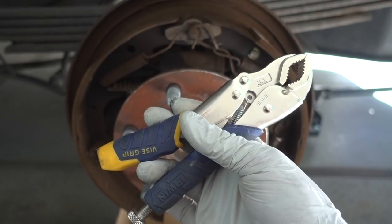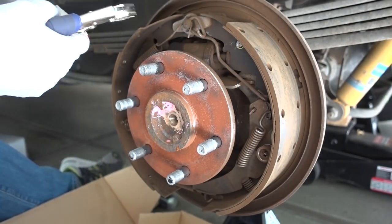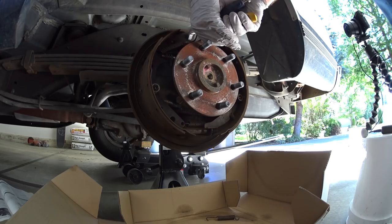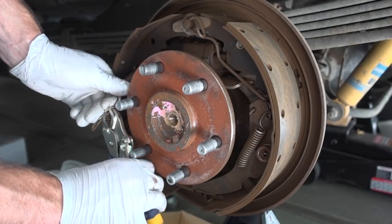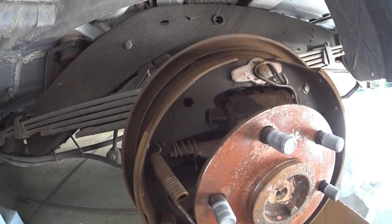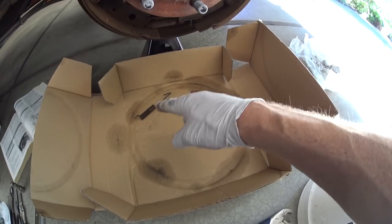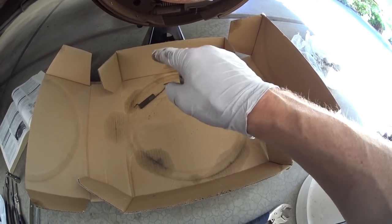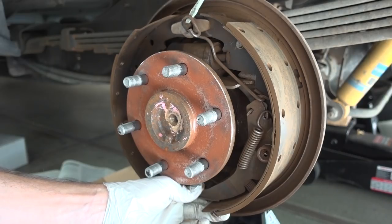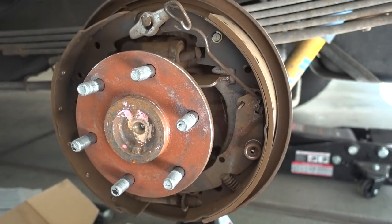My tool of choice is going to be a pair of vice grips. Just pull that one off — first spring off. Time for the next spring. Pull — and one more time. You can see that one loops in there and this comes right out. I have the drum box and I'm going to lay these springs out kind of the way they are, to give myself a reminder of which ones went where. There's a spring here — yep, that did it. This thing in here looks like it just slides right out. I'll go ahead and take that out now.